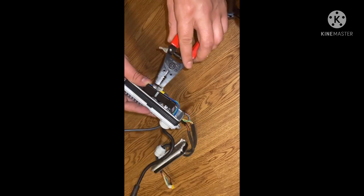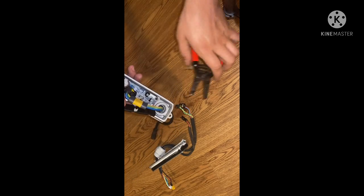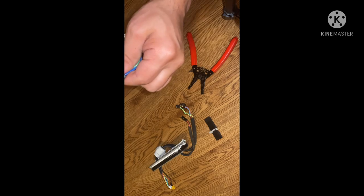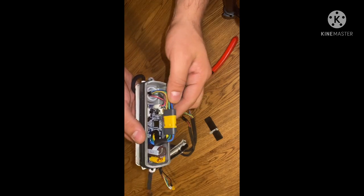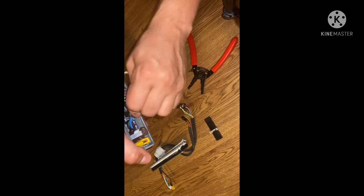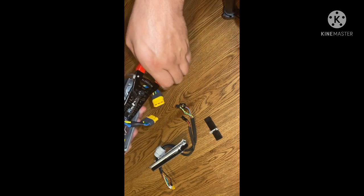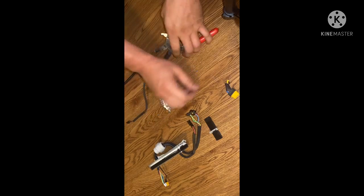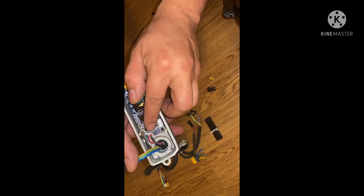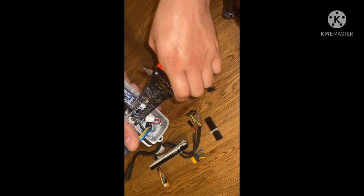What you're going to do is cut this brace off of your motor line — it just holds it in place. You want to keep these wires, so pull those apart and clip them because this is what's going to be needed. I have my motor phase connected — I'm going to hold on to that. Pull these little tabs off: this one goes to your backlight, and this is your hall effect sensor — those are going to come loose.